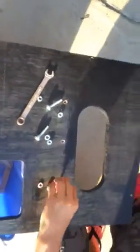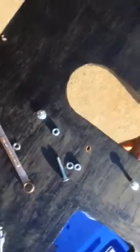Go ahead and put the bolts in the other three holes. Just get them started. Might have to move the bracket a little bit. Take the bolt out for a second. You're not lined up. Okay, now try it. Should go now. Hard for me to help you holding a camera. And if you can, you can hold a washer and a lock washer and a nut in your fingers. Do it in one shot.